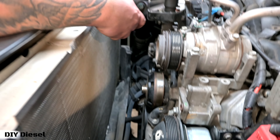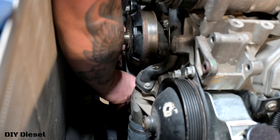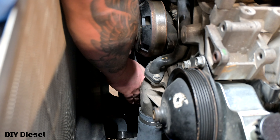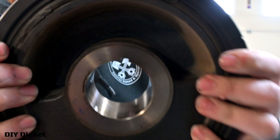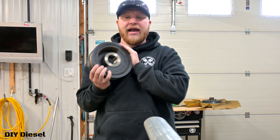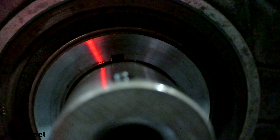There she is. There's the bolt and there's the washer. Now that bolt's out, go down there with two hands and take that harmonic balancer out. Be very careful with it — just kind of wiggle it on out of there. That's your harmonic balancer. Go set it down on your table. Also, by the way, there's a little key here. When you go to install this back in, you need to make sure you line that key up — it's very important.